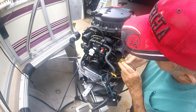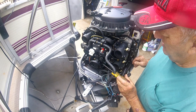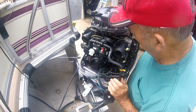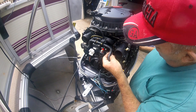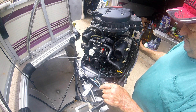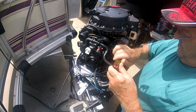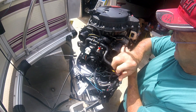Is there any chance I can get that nut screw off back there? No. You booger bear. We know we can get on that screw there. It looks like once I get the carburetor off, there's still going to be a thing in the way — but it's just a nut, so we can take it off. What a pain in the tail. Let's find a socket to fit that carburetor. The carburetor is installed with four nuts and one screw — the screw is gone.